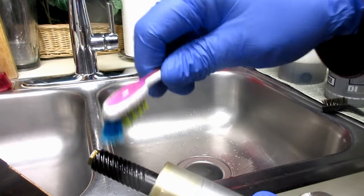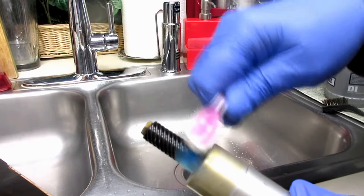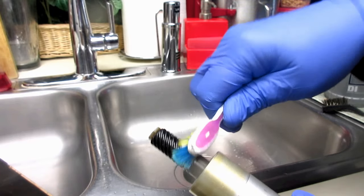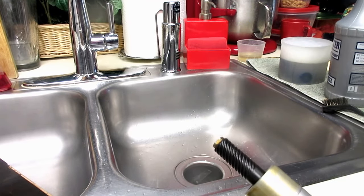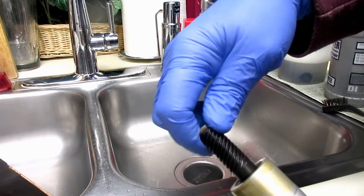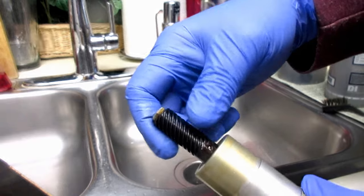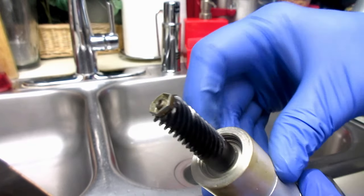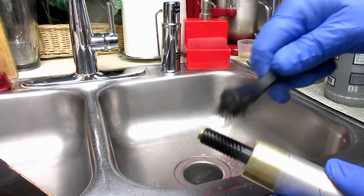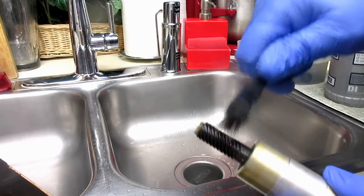If the pinion gear here that mates up with the hand wheel is grungy and dirty, you can do that dry brush, where you try and brush off the excess, and then I would just leave it at that. If there's any old gunk, like that white lithium grease that dries like a rock, you're going to have to scrape it, but really avoid getting anything down in here, okay? Wire brushing, that's okay. You can use a stiffer wire brush. This is metal.